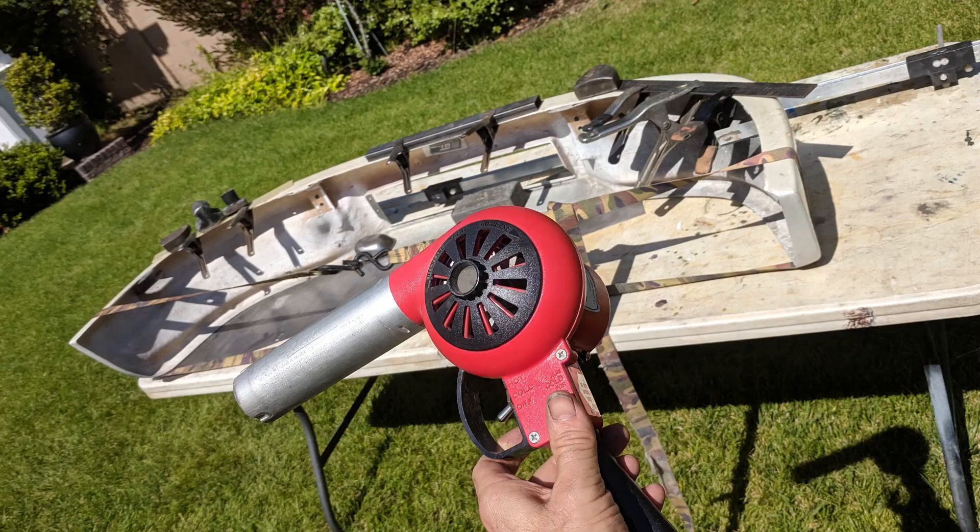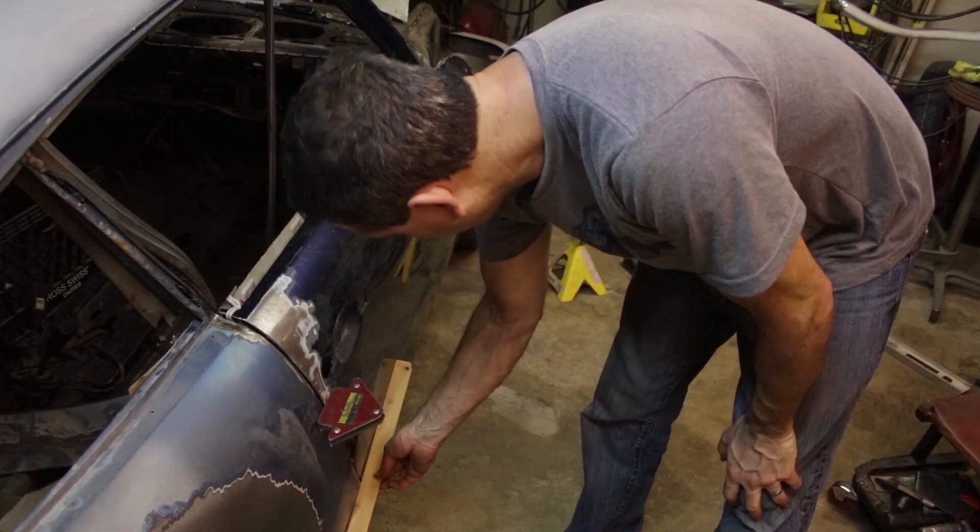you've got to make sure it fits the car first. That was the case on this bumper — it didn't fit the car at all. It's fiberglass, so I ended up bending it to shape. If it's metal, you have to cut it, twist it, bend it, do whatever you need to do, but it's got to fit the car before you start the bodywork.